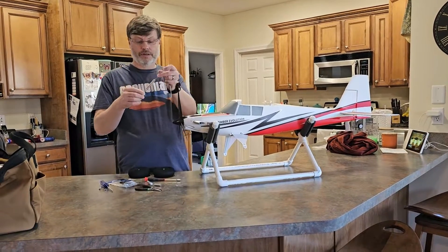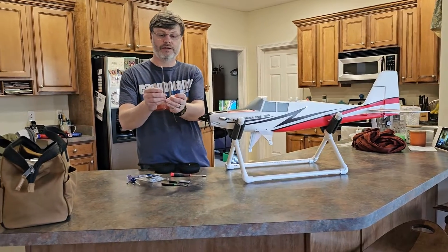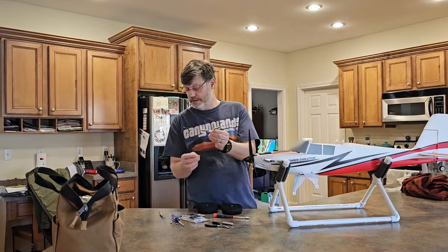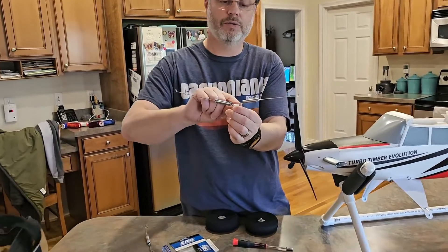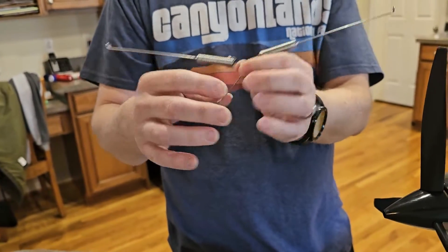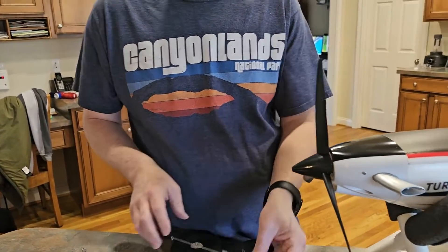It consists of these springs, and if you compare them to the ones — there's considerable difference between these two right here on the strength. This is actually the problem with the gear on this airplane: if you hit the ground hard at all, as you can see, this set right here is actually already bent. They usually bend right in this area here. So it bends, and then one spring becomes softer than the other, and then with the weight of the wings on the airplane, the airplane sits kind of cockeyed or a little bit slanted on the runway, which isn't good for takeoff and landing. So I think we've come up with a way to fix this pretty cheap.